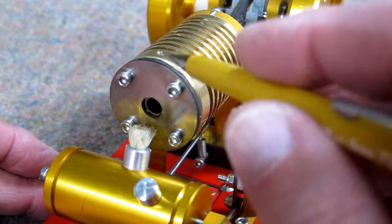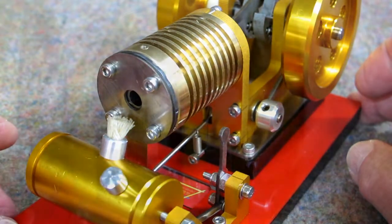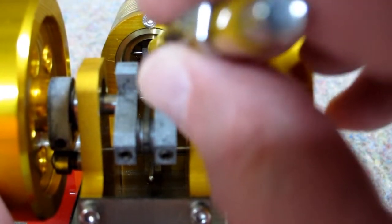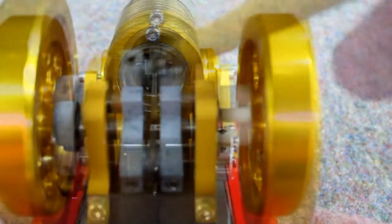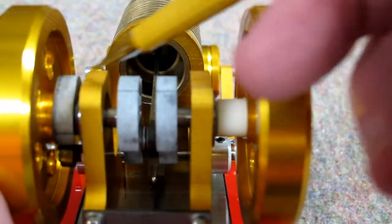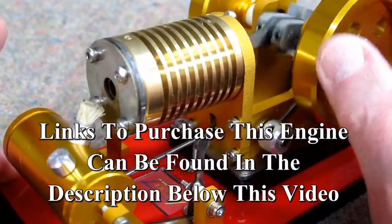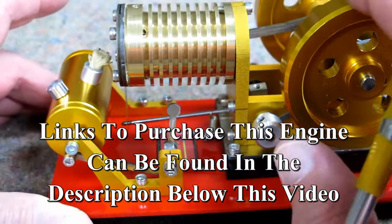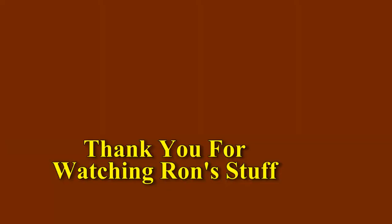I have not put any oil in here for that reed valve — I'm running it dry. I'll try to get up in here and put a little oil on this wrist pin for the connecting rod without getting oil on the inside of the cylinder. A little oil here for the lower end of the connecting rod, a little oil on this cam. This cam follower is running on bearings as well, so it doesn't really need any oil, at least not for a while. And that's it — not too long.